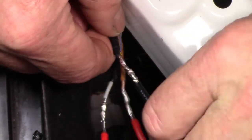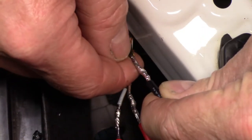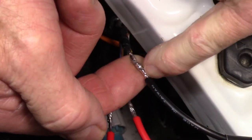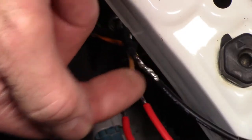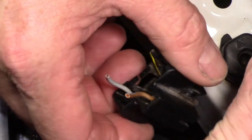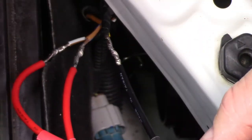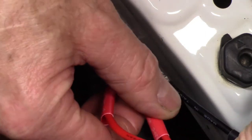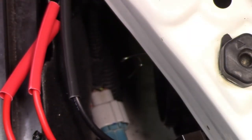All rinse and repeat — just a matter of soldering on correctly. You want to get these wires together mechanically to make your soldering a lot easier. Then you heat up the underneath of the wire to get it hot, then just touch the soldering iron there and eventually the solder will leech through via capillary action. You put the solder on top of the wire and it'll eventually melt all the way through. I've done all three and checked them against my original connector. I'm happy that I've got my black, my brown, and my grey in the correct order. Before I get excited and heat up the heat shrink, I'm just going to hook up the globe first to make sure I've done it correctly — no use re-soldering the wire because you've got it around the wrong way.